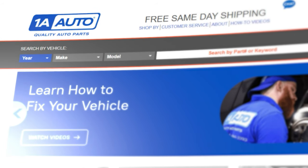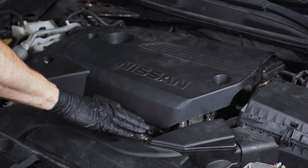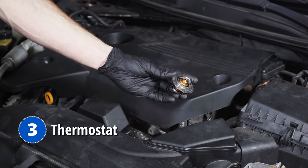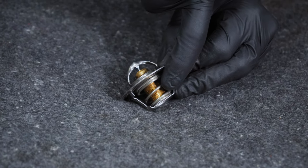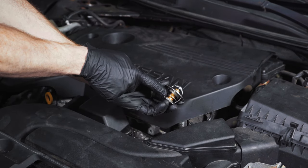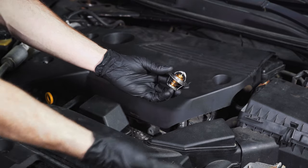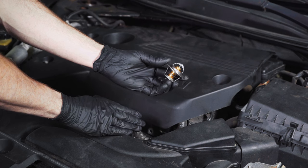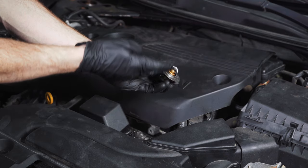Cleaning the throttle body is a fix, but it may not work every time, especially if you touched the butterfly valve and caused an issue. Better than that, you can order a brand new throttle body from 1aauto.com — the installation is fairly easy overall. The next problem we'll talk about with these engines is an overheating condition, which typically comes down to a thermostat issue. The thermostat itself is responsible for regulating the temperature of your engine. Once the coolant reaches a certain temperature, it's going to cause a change in the spring, which retracts the valve.